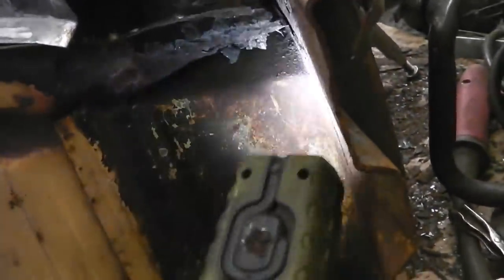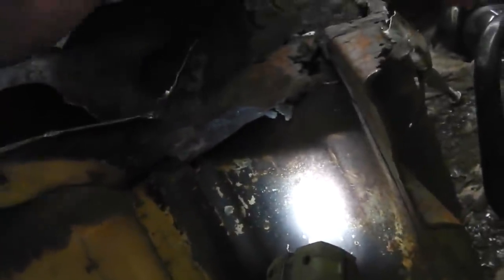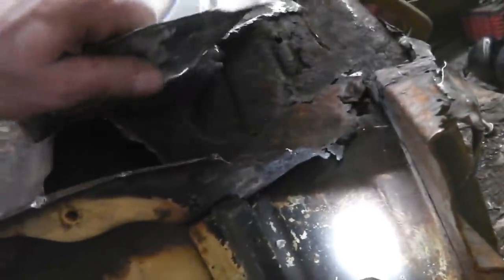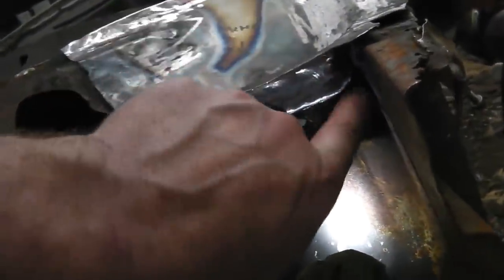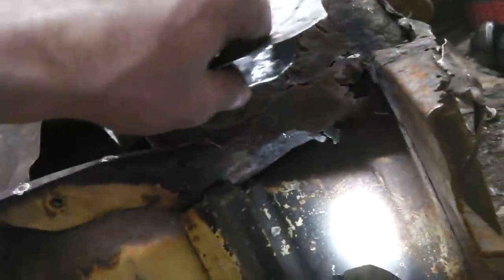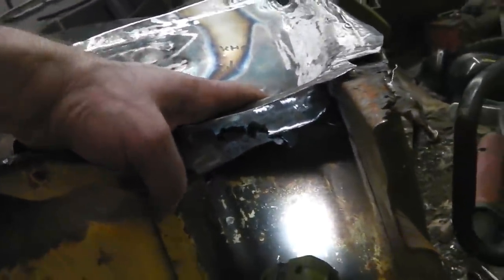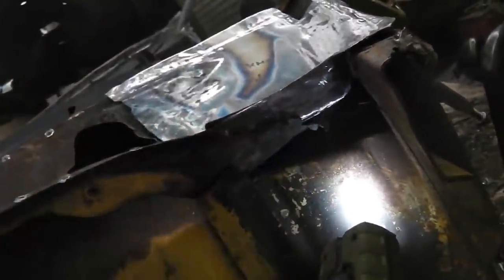So you're talking about when you're looking inside your car, you'd be looking in this area. That's what you're going to see. So when this lands, this can be taken off now. This will recreate, there you go, obviously we'll have a nice finish, this won't be on, and you're going to see that piece, and that's landing on the spot weld point as well. I can feel it bottoming out, so we've got the height to reach the spots to anchor that down, so you're going to see pretty seamless continuation of this inside, so we're good there.